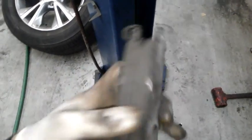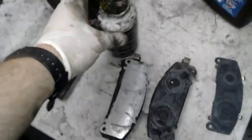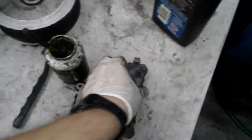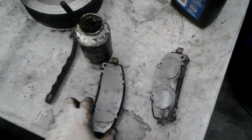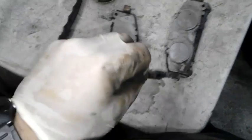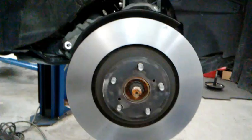I'm gonna look at my pads here. These are OEM pads and they have these OEM shims. You can switch the top clips over to your new pads. If you're using OEM pads you're going to want to switch these shims over too. You can put a little bit of lube on the back to help it stick to the pad. If your new pads don't come with these or if you're using aftermarket pads, just don't use them — especially if they don't fit on well. These are mostly just for OEM pads; they just slide back onto your new pads. Also put a little lube on the top and bottom edges of the pads so they slide better in the hardware. If you got new clips, use those.